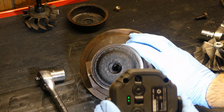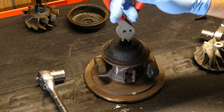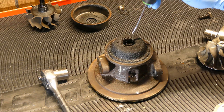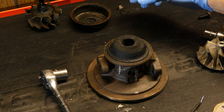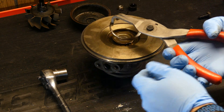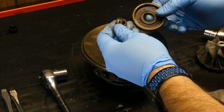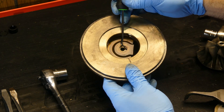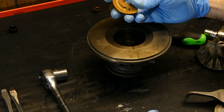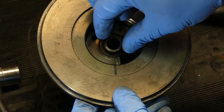It's time to disassemble the cartridge. These are all a little different but pretty similar in design regardless of your turbo model. Take it slow and lay out everything you remove in order so you can put it back together easier. There's a small clip holding the oil bearing in place so I'll start by removing that, then use a pick to fish out the bearing. Flip the cartridge over and work on the compressor side. To get the main cover assembly off, remove a larger c-clip then pry the cover off. This is usually a two-piece cover held together with a spring clip, so be careful when you separate the parts. Next, reach into the cartridge and remove the oil deflector and the thrust bearing — a two-piece design, so pay attention to how they all fit together. To get the oil bearing out there's another c-clip to remove, then fish it out. There should be two bearings like this on most turbos.